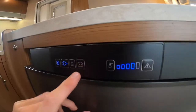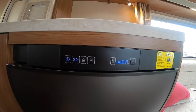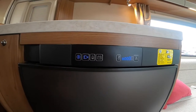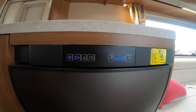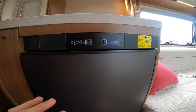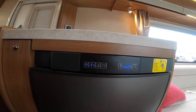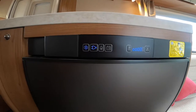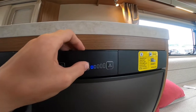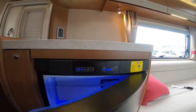The battery setting turns the fridge into a large cool box and maintains the temperature it was previously set at — so it must be pre-chilled beforehand. A couple of days before your trip, hook the vehicle up and put the fridge on. The night before, go shopping, put your shopping in, allow it to chill overnight, then when ready to drive off, unhook it, start the engine, turn it to battery and drive. Always start pre-chilling at full temperature, then drop it to three or four when you put your shopping in, as some people find it gets too cold and shopping can perish.